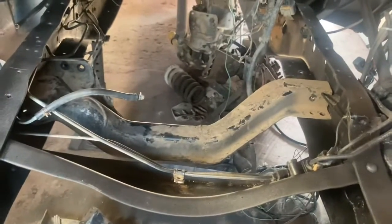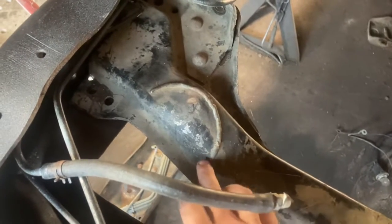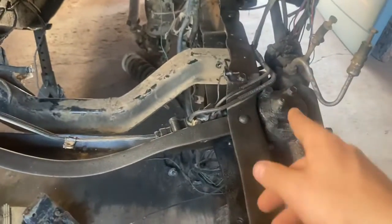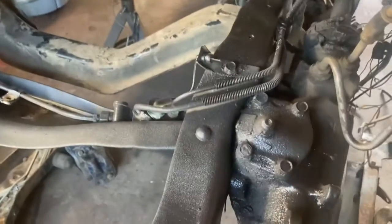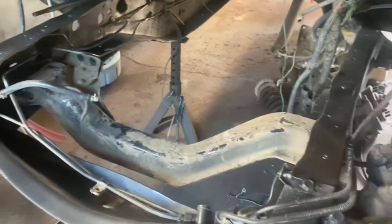Or I could always make my own cross member if that's stronger than factory, because as you can see this one's already broken. This is a common problem with these cracking. I fixed this a long time ago and I don't even think I drilled the hole properly. I might grind this all down and fix it again. Another thing with these is shear cracks — there are plates you can buy for the power steering box. That cross member and that are the common problems. I'll probably end up having to plate this at some point, especially if I ever go to a crossover steering system. I'm going to go with the factory push-pull on the side — I'm not going crazy lifts, so I shouldn't need to go crossover.